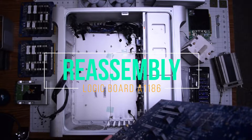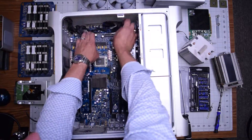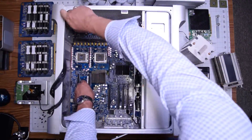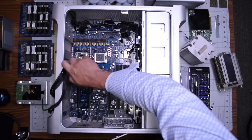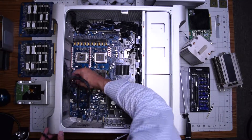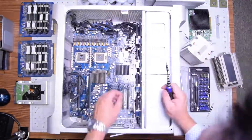Logic board reassembly for Mac Pro A1186. Gently place the board into the following orientation, making sure you're not blocking any connections — especially the Bluetooth and Wi-Fi antenna cables and the cables up top. Make sure everything is unpinched. Secure the three Phillips head screws on the top, one on that side, three on the bottom, and one on the middle left side for eight total screws. Secure the connection in the bottom right, then the left audio cable, the peripheral cables, the power, the IDE cable, the SATA cable, the sensors, and that entire right corner.